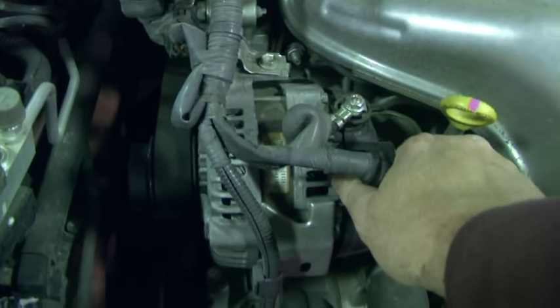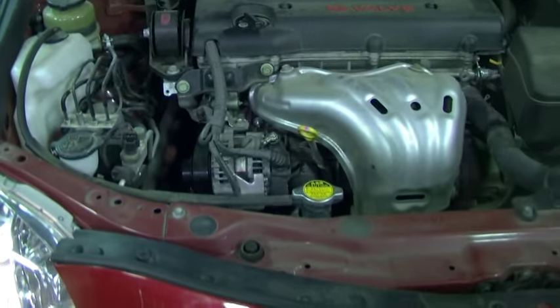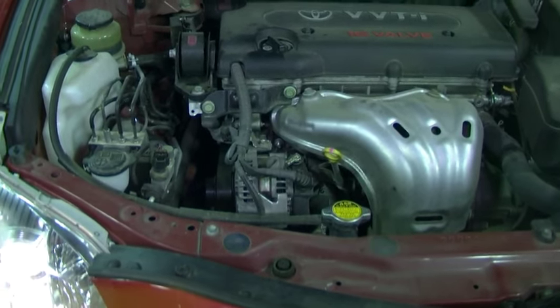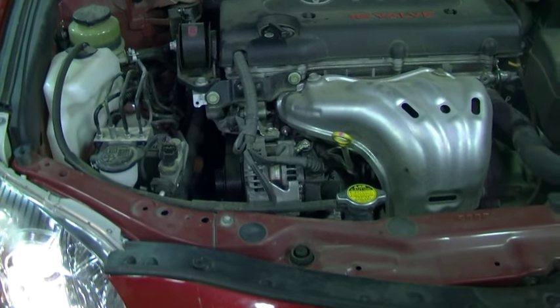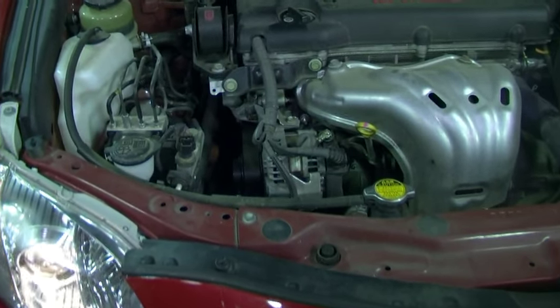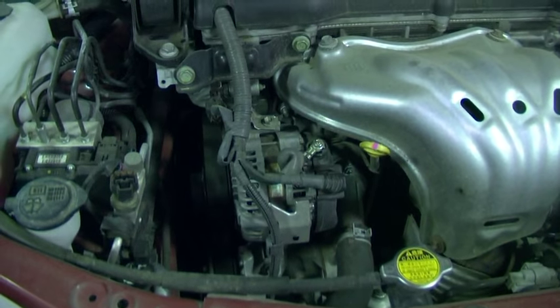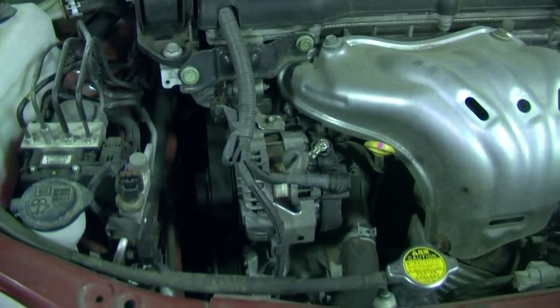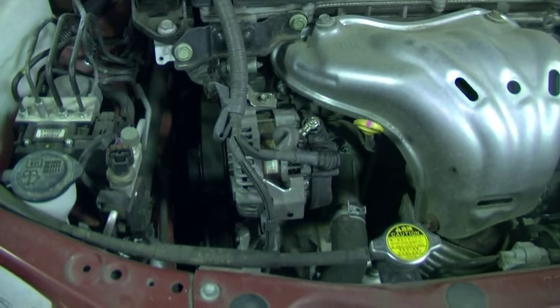It's got some noise in our alternator. It sounds like it's probably the diodes. Sometimes the diodes will get shorted in there and they'll make a whining noise like that. You don't hear it very often, but that's what that sounds like. We're going to take it off and check it and see if the bearing or anything else in it is bad. But it does sound like the diodes are whining — that's a diode whining.